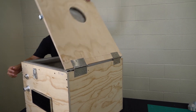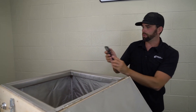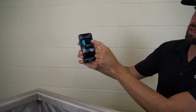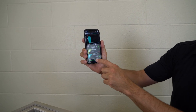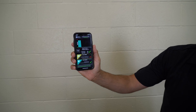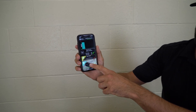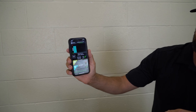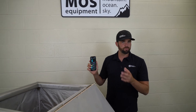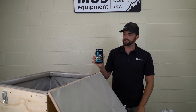I'll pop it open here. That's exactly what we want to see — at about 15 seconds, that's about how long it took me to latch it, the signal went all the way down and was completely blocked. We show Wi-Fi signal blocked. The test went well. Do this with 5 gigahertz, do it with cell — I test all of them. Generally speaking, if Wi-Fi works the others like cell and Bluetooth should too, but you still want to test.